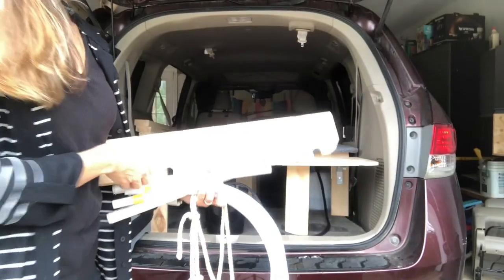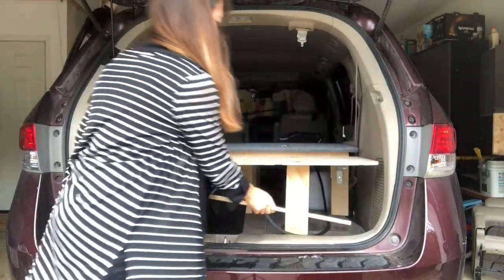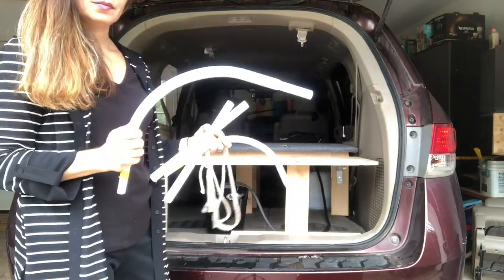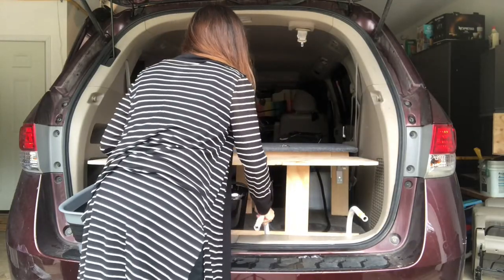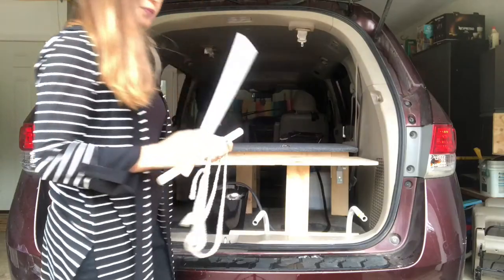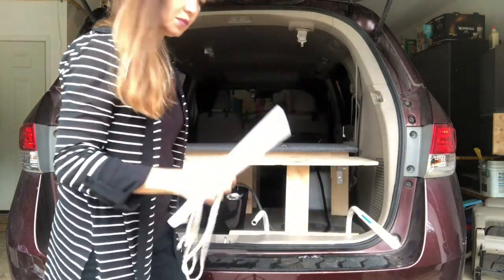I'm going to try to provide links to all these products in the description. My third row seats are folded and stored in the trunk of the van, so I can shove these tubes down into the crevice, and the stored seats make it tight enough to hold them in place. Because they have a tendency to shift from side to side, I cut a piece of plywood to fit into the right side of the van and drilled two holes in it to use as a spacer. That works well. Now I needed to extend these tubes to give something for the sink to hang onto. I ended up finding half-inch PVC pipes that were pre-cut to 24 inches long and fit nicely onto the ends of these curved pieces. Because they fit a little loosely, I wrapped a piece of electrical tape around the ends of the curved pieces to make the fit a little tighter.